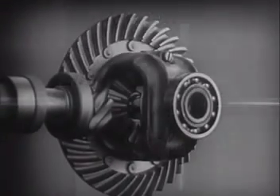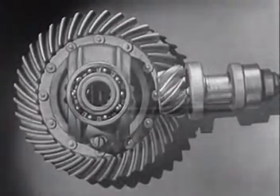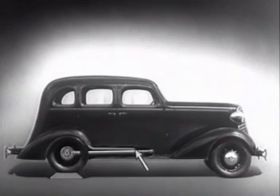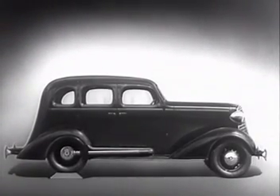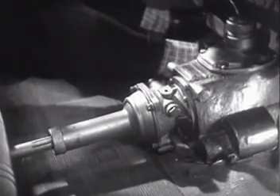We can make our model more compact by moving the gears closer together. When we put our differential in an automobile, we have to leave room for the drive shaft, which carries the power from the engine. We may build the floor of the car above the drive shaft, but if we do, we won't have much room inside unless we make the top of the car high too. Of course, we could lower the floor and ceiling, but the drive shaft would be higher than the floor. A shaft in the middle of the floor of an automobile would be inconvenient for passengers and would be awkward for carrying luggage.